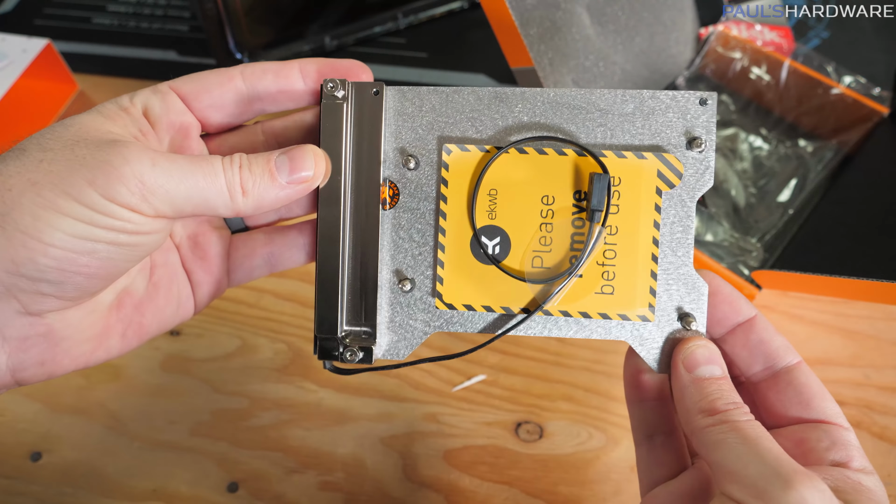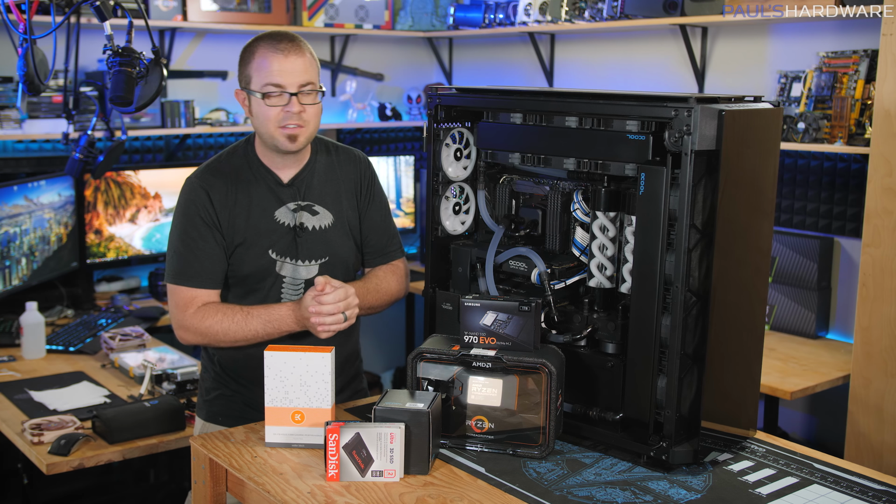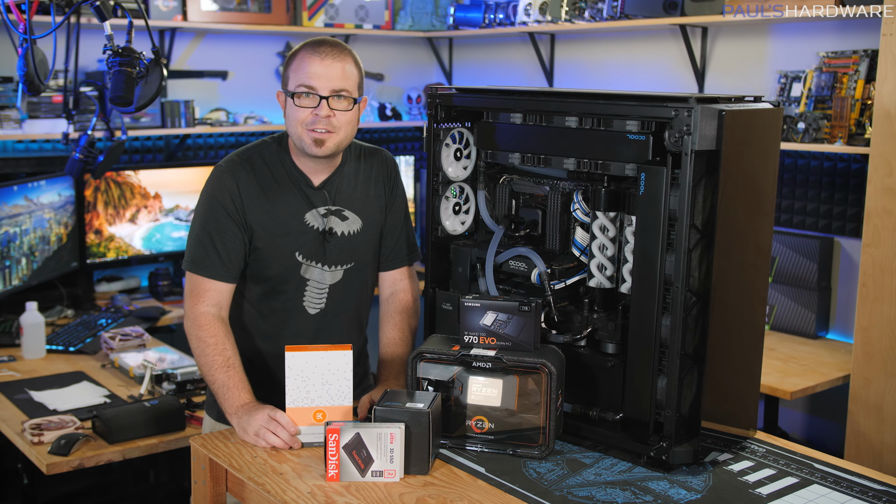The last thing I wanted to point out before I get into this is that this was kind of what the system was designed for. This is a water-cooled system. Water-cooled systems, especially custom water-cooled systems, are notorious for being difficult to work with and upgrade. My whole goal with this system, which I did by including quick disconnects wherever I could, was to make sure that the water cooling loop could be disassembled and pulled out of there, and even if I wanted to do something as crazy as swapping the motherboard out or adding a monoblock, I could do that, hopefully without too much trouble.